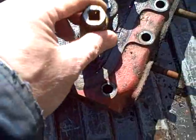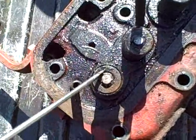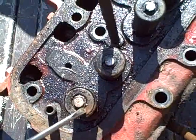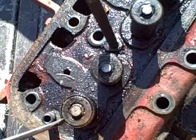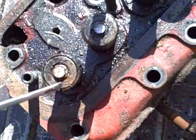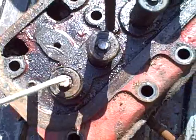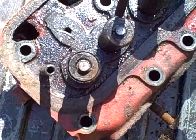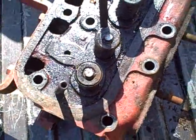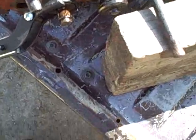I got an old socket and I tap it to see whether or not this is stuck. It seems to be broken free. Now I can push down with my screwdriver — you can see I can actually push the spring down and the valve keepers and the stem are staying up. So I am going to reapply the valve spring compressor and see what happens. Yeah, that was it. Works like a charm now.